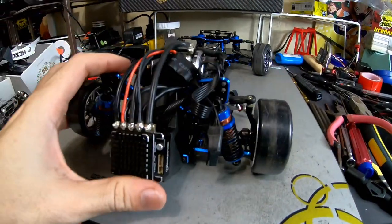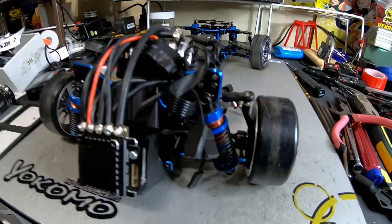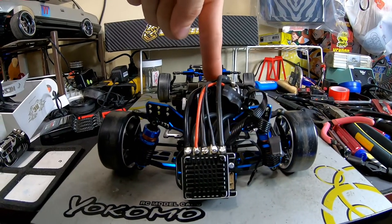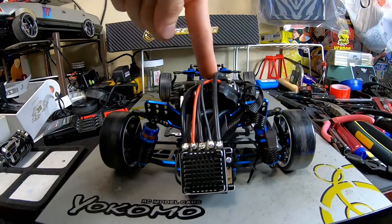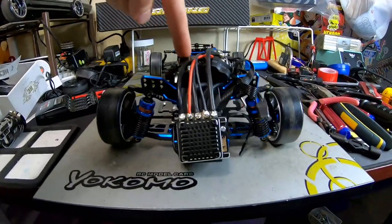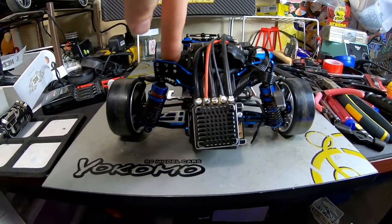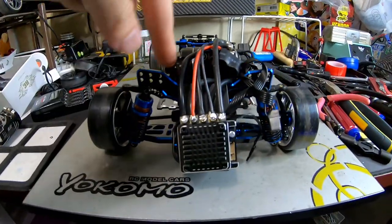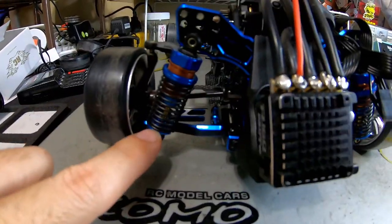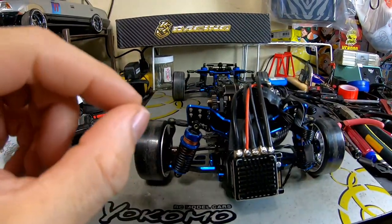The other major thing I considered was checking the shocks and re-oiling them, but I decided to leave them as done at the factory to see how well they were done. They weren't done that well - if I push the suspension, notice how one side is going down and this side is a little stiff. They were a little stiff from the factory. Not only that, when I actually checked to see how much rebound there was, there was barely any rebound of the shaft coming back out of the shock after compression.